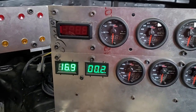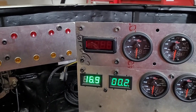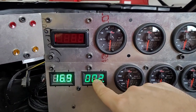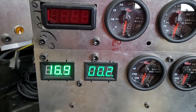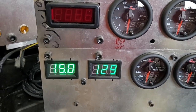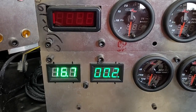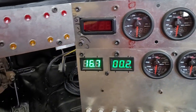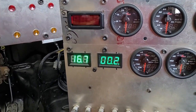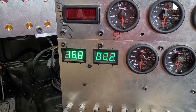Here's our starter — we can actually hit it. Now it's a bit weird, we only have like three spark plugs installed and one isn't installed, but check it out. You'll get to see the current — how many amps the starter pulls and our battery voltage. There we go. It sounds weird of course. Starter works — that's pretty cool. It pulls like 120 to 130 amps.